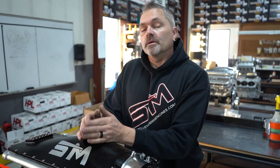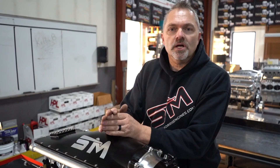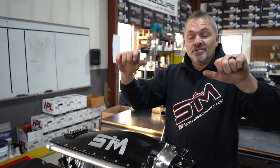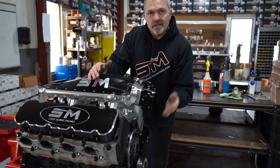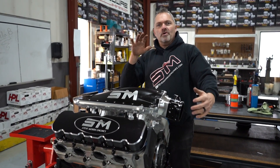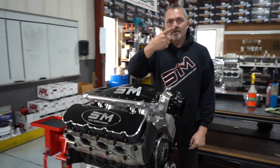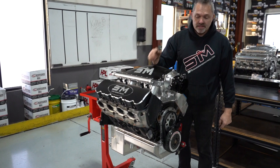This thing — everything is fine. We pulled the number one main bearing: it looked like brand new. Pulled the number two main bearing: it looked like it had a little bit of touch on the coating. Not a big deal — exactly what you'd expect, because just like that rod bending, that's actually what's going on. Now what is only bending? Because I just showed you that the mains are holding the crankshaft, that part is not doing anything. Cylinder pressure pushing down on the crankshaft doesn't keep things straight — it's not counteracting anything. The crankshaft's bending there. That was 100% that snout of the crankshaft bending like that.